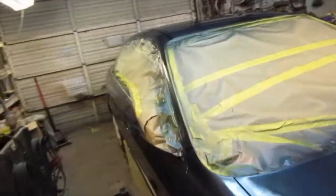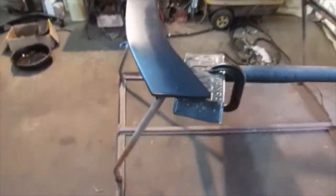Top's looking pretty good, kind of hard to tell. A few little dents in there that didn't need to be fixed. I still got about half my paint left. My wing might need two more coats. Here's my test panel — you can see it's starting to flash off. See that kind of drier edge. I'm going to give it plenty of time between coats because it's so humid out.